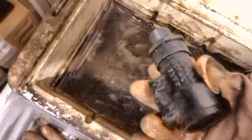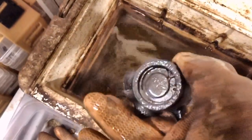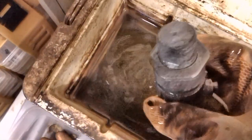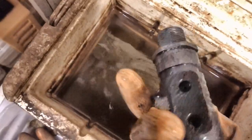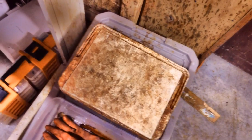Let it sit in the old vinegar for about a week. It's been about a week — let's take a look. Nice dark vinegar. Oh yeah, that's looking real good. That's the end I really cared about — that's where the snap ring is and where I have to take that locking collar off. The rest is not too shabby. I'll leave it in there for about another hour, then take it out and wash it all down.